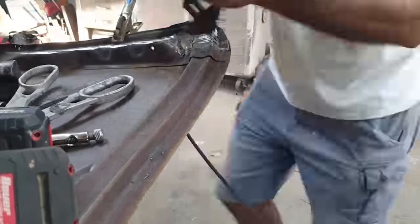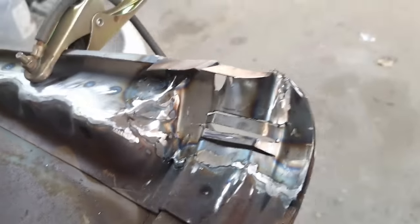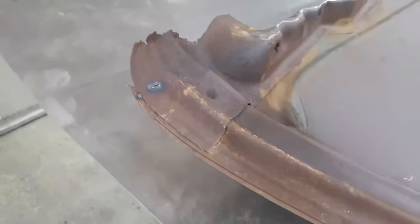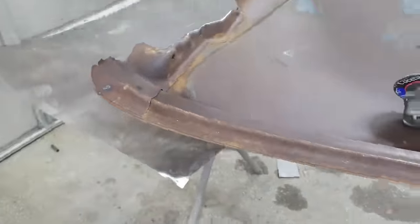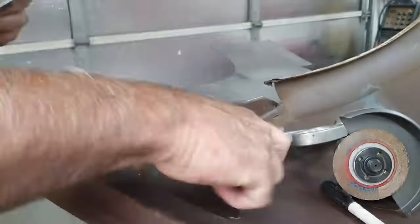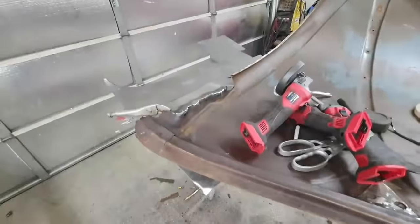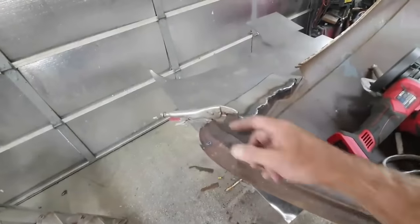Getting the hood to fit correctly was difficult. When I put it on the car I went by eye, because there's really not many other ways to do it with all the angles. I set it on the car and checked it before putting the filler on, and it was pretty much in spec. Those are really common rust areas on early ovals — 54, 55, and earlier, even the split windows had issues with the hoods in that same area because water would get behind there and rust.